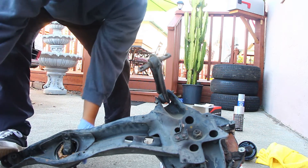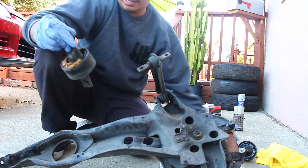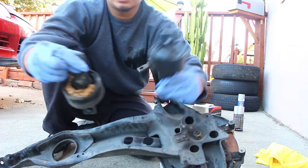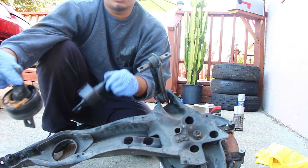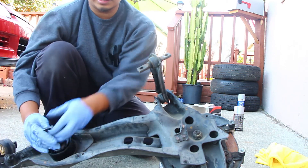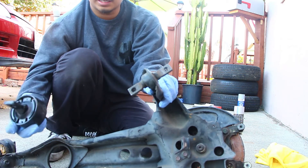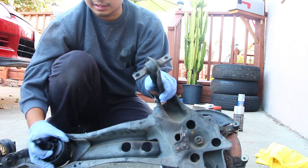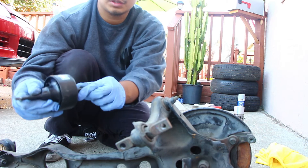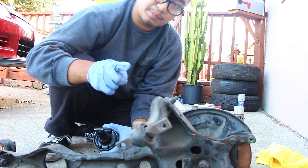It's removed! Remember guys, it's different on both sides - you don't want to install it going this way. You want the longer side towards the inside of the trailing arm. So it's going to be like this - not where the short side is on the inside, you want the long side like this. Then the line we made - I'm going to make sure it aligns with this part. Go ahead and reinstall it, just hammer it back in.